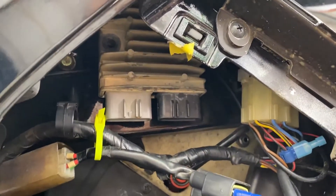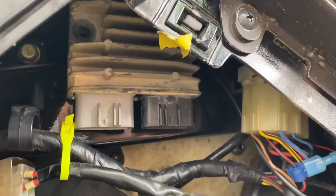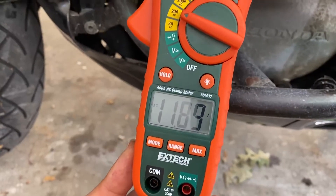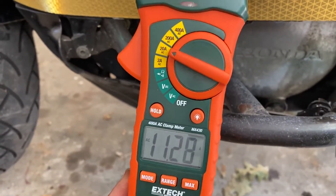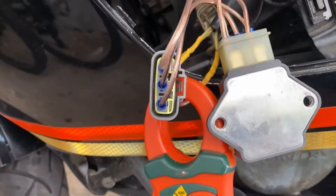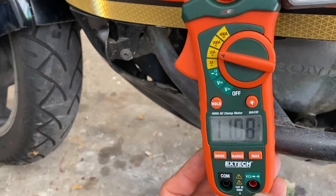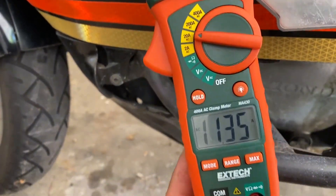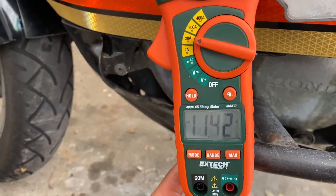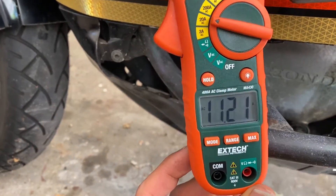You can see my SH-775 — it's not plugged in right now, but that's what I normally run on the bike. That's my idle charge current AC measured at one of the coil wires. I'm just going to do relative measurements and only measure one coil wire. They should all be the same, so that way I can measure everything relatively.